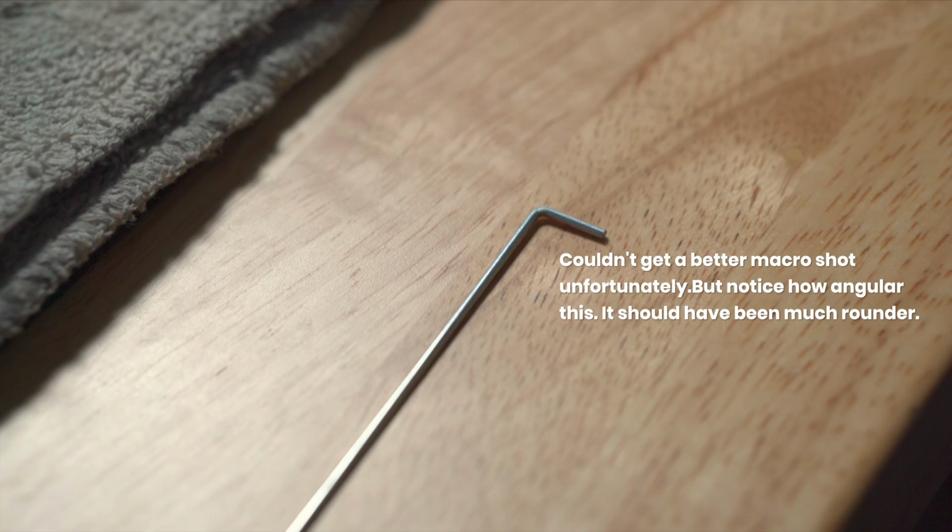Now this keyboard does come with Keychron's own screw-in stabs. Now for whatever reason the spacebar was giving me the most trouble. Their stabs on the other ones, the 2U ones, were just fine out of the box. I really had no issue, but the stab on the spacebar was, I think, a little overzealously lubed. It was sticking a little bit, and once I took it apart, the stab wire was so much rougher than the other ones. It felt like it had not finished machining, actually. It was the roughest stab wire I had ever dealt with on any keyboard, and I don't know why.